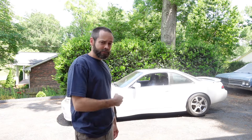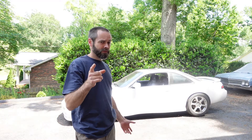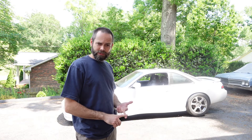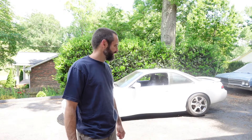Welcome back to Next Life Garage. We're back with the Nissan. Last time we signed off on the Nissan, I mentioned we'd be looking at some of the stuff in the FIC — the fuel ignition controller — used to manage things with the turbo. But I left out one big step before we tore it down to rebuild it. I did a lot of monkeying around with the idle air control valve, throttle position sensor, and throttle stop switch trying to tune out a bad cylinder. I just didn't want to believe it was as bad as it was at the time, and we couldn't get it worked out.